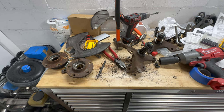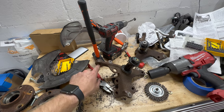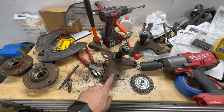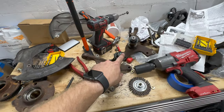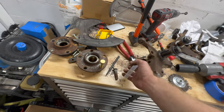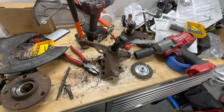This is very different from last time. I need these spindles that I had up top, as I showed you guys, to have the drilled-out tie rod end location, so I got the ones from up top. I removed the hubs, smacked the studs out, and removed the dust covers and brake dust shields. I'm either going to put new bearings in these or get new hubs entirely, and I'll be putting three-inch studs in whatever hubs I have. I wanted to get these set so I can clean the rust off — I want my spindles to be nice and pretty, kind of like everything else has been.